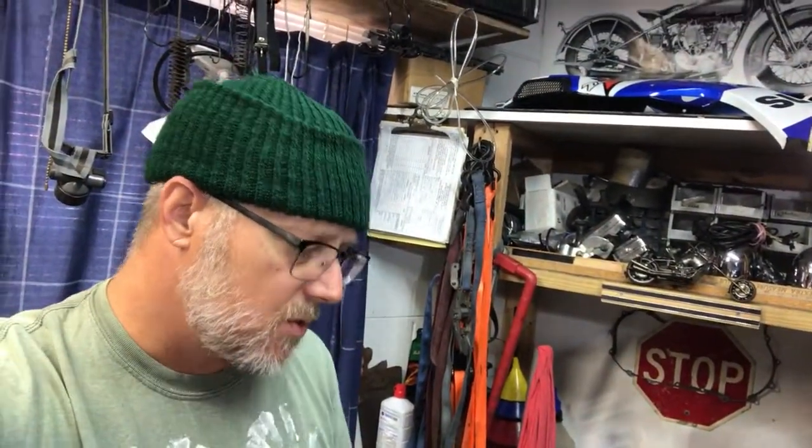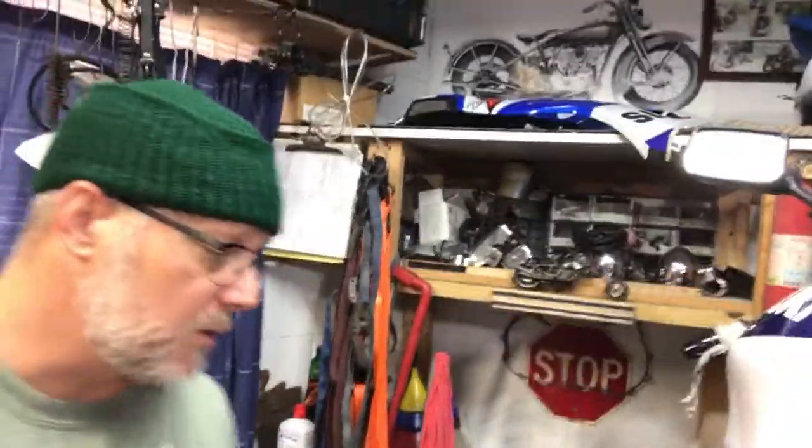Now, I also looked over the bike. The customer had stated that after riding the bike hard, he would notice a bit of oil seepage coming down from the lower fairing on the left side of the bike. I had to pull the body panels off to get to all the electrical connectors hidden underneath to do this ignition stuff. So I did a quick look at all the covers and housings, and the stator cover's been pulled off, the clutch cover's been pulled off, and what I found was all of the bolts on both of those covers were somewhat loose, not completely torqued down properly. Some of them were pretty loose. So I think what we have was a little bit of oil seepage just from that alone. So we torqued it down properly, cleaned up everything, got all the oil off the bottom of the motor.